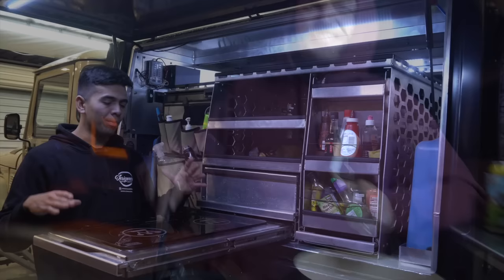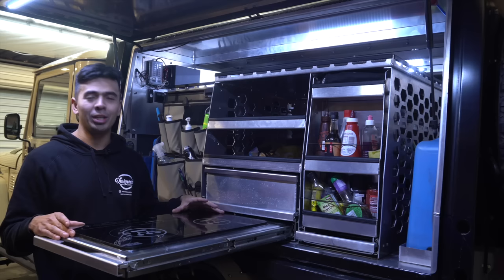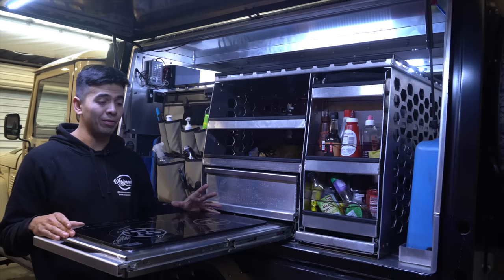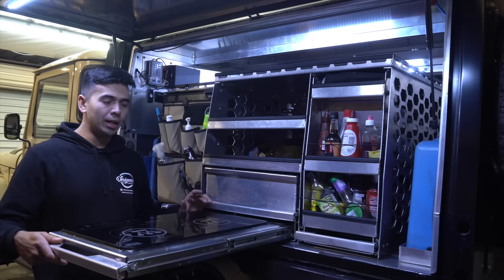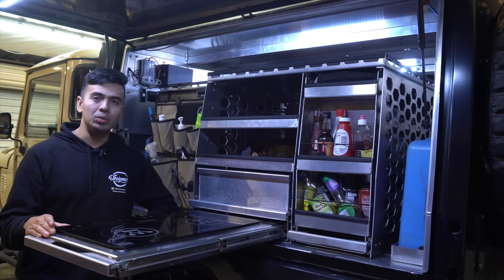The best part is the burner's only about $200. You just need 5kW of 12-volt supporting it, which we'll cover in a future episode. I've tested it on the road for a month. It pulls a lot of current, so you've just got to future-proof your 12-volt system. We've had to get a licensed electrician to hardwire it all into the 240. A lot of you might be thinking: why induction? Gas is old school and simple. I'll tell you why — because I don't want to carry a gas bottle around.